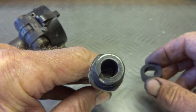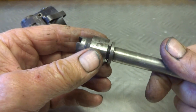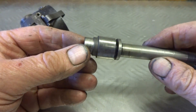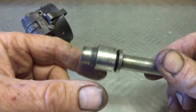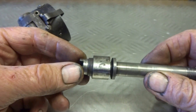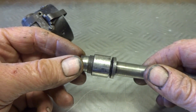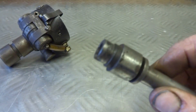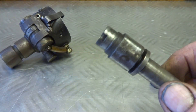The shaft has to be ground down. The problem is that it's case hardened. I took it to a friend to turn it down on his lathe, but it was so hard that his lathe didn't touch it at all. So I had to grind it down on the grindstone to get a rough shape, and then very carefully use a file to grind it to the right size — a good, reasonably tight fit. I don't have a lathe myself, but I do have a grindstone, so let me show you how I did it.